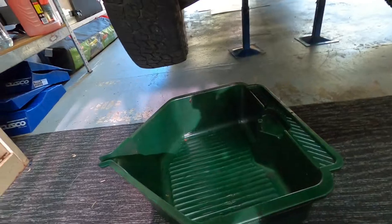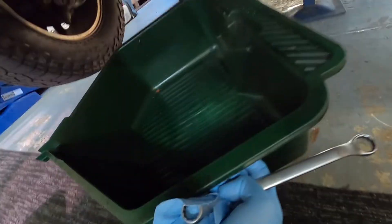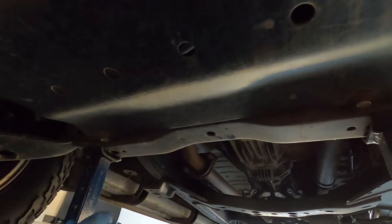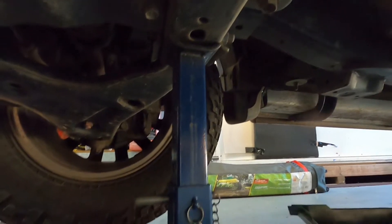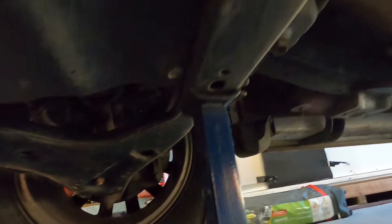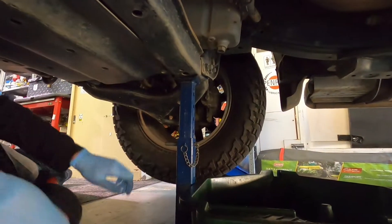Now that we're underneath, the first thing I always like to do is drop the oil. You'll need a decent-sized drain tray - something that holds at least 10 litres because you've got 8.5 litres to come out. When you're jacking it up, this is your jacking point just behind the sump guard. If you come up underneath and look straight up, there's your sump plug for the engine oil. We'll crack that sump plug now - with diesel I always wear gloves because it's filthy, you always get it on your hands.